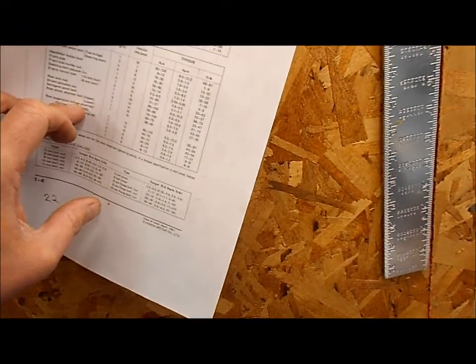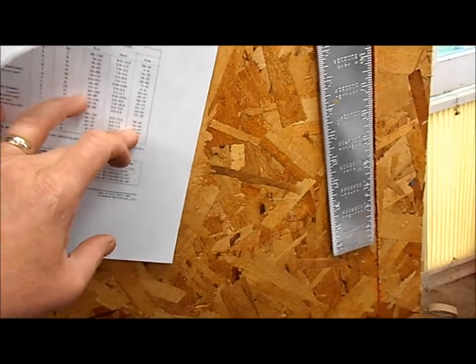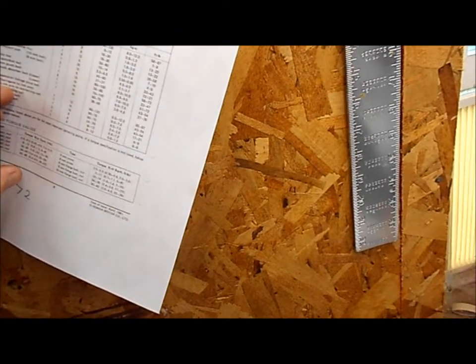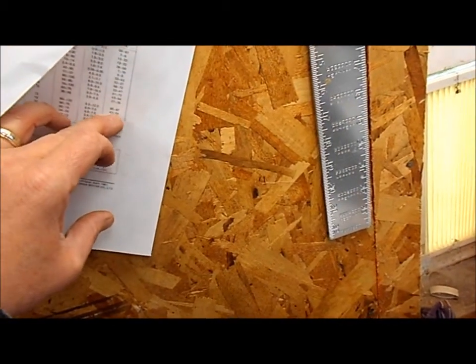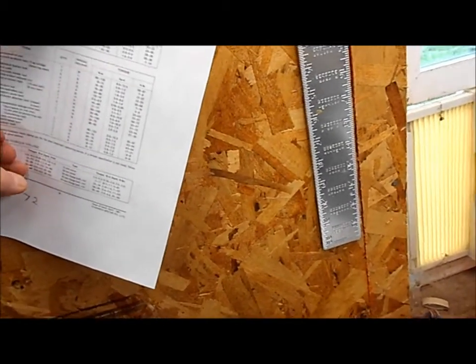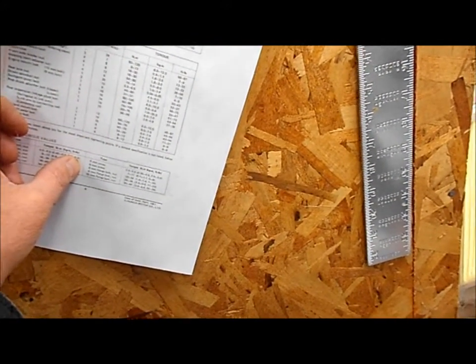The rear suspension linkage pivot bolt, the swing arm to link arm, is 65 to 87. Link arm to connecting rod is 43 to 54, and the connecting rod itself is 43 to 54. If you need me to repeat those, just send me a note and I'll post it on the site. Thank you.